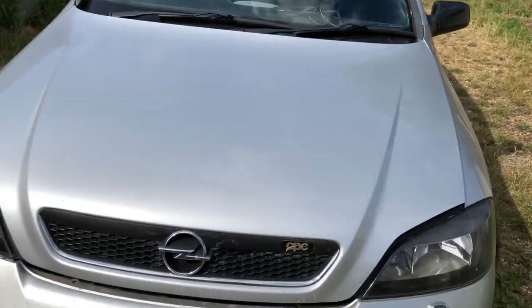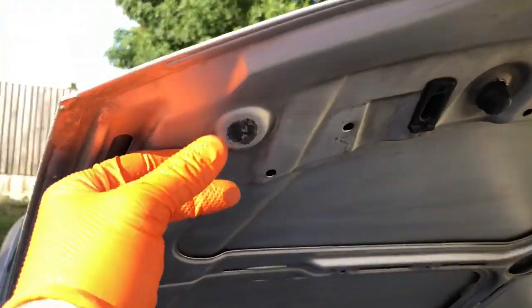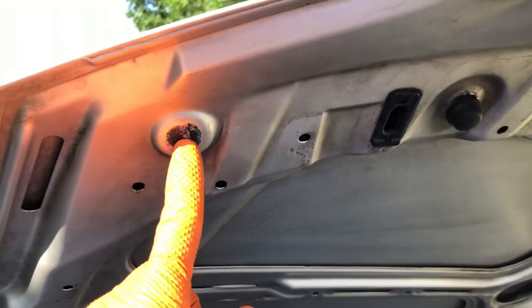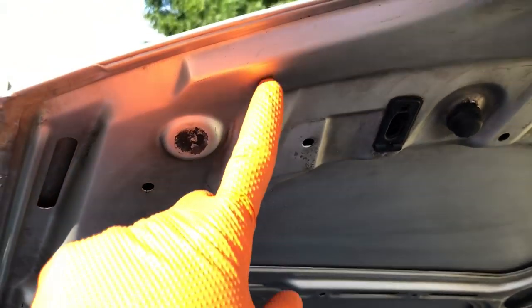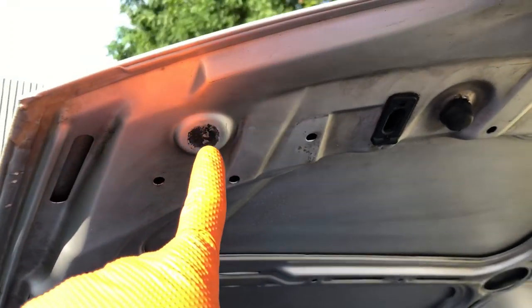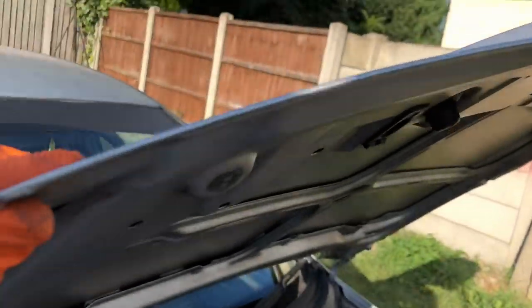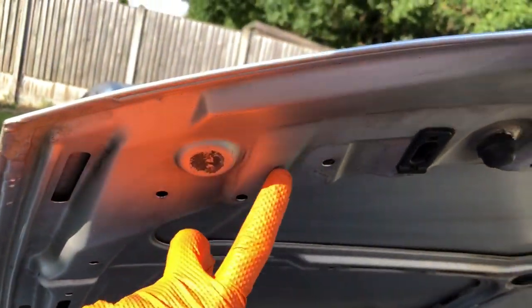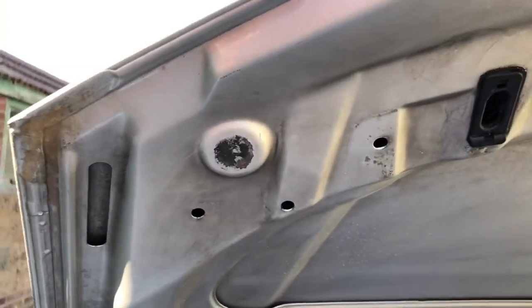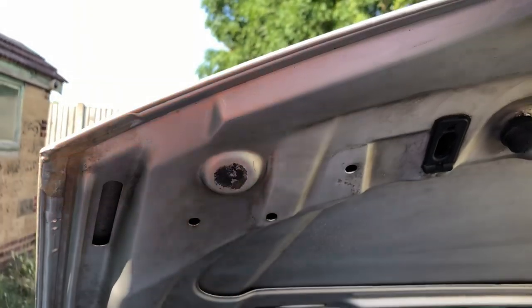There's no catch in the middle of the slam panel, so what I'll do first is measure the centre of this round part here - that's where the pin's going to go through. I'm going to bring this out quite nice and big and cut around here for the inner skin as well. Pop that through, centralise it, and it goes through the back of the bonnet. Then you can drill on your template. So that's where I always start - drill your hole through there which the pin goes through.